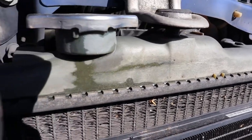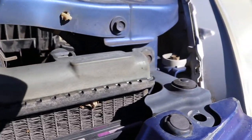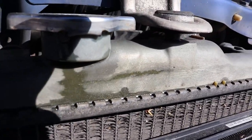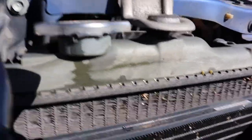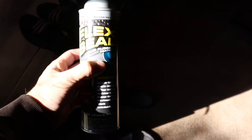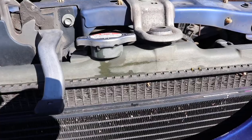So I looked it up. To repair this, some people buy kits that basically melt plastic over the top — the whole top piece is plastic. Others say you can get zip ties, melt them with a soldering iron, and that fixes it. But there's something I always wanted to try: Flex Seal. I got the gray one because they were out of black. It's liquid rubber, similar to melted plastic, and it's rated up to around 320 to 350 degrees before it starts to melt — perfect, since your radiator should never get that hot.